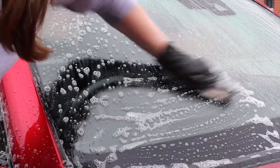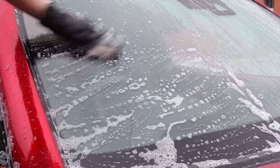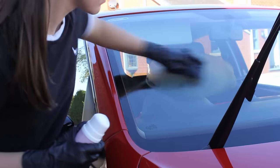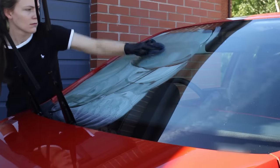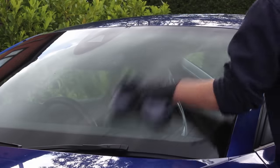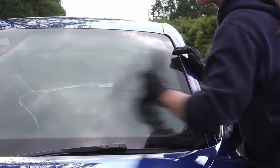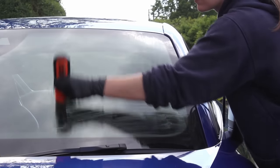Simply using a glass cleaner or a clay bar isn't going to remove that kind of contamination. At minimum you need a water spot remover, but ideally you should polish the windscreen. Glass polishes I've tried and recommend are the Soft 99 Glaco Compound, Carpro Seriglass, and the Tac Systems glass polish — all three work really well at properly preparing the glass and removing all types of contamination. After using one of those, use a glass cleaner or panel wipe solution to remove any residue before applying the glass coating. This reduces the risk of those issues and makes the coating last much longer.